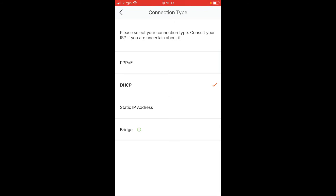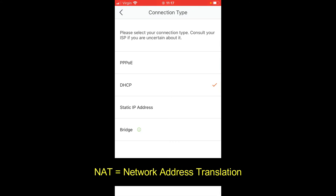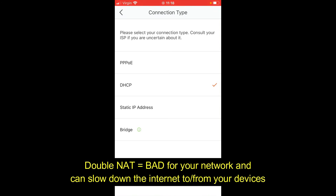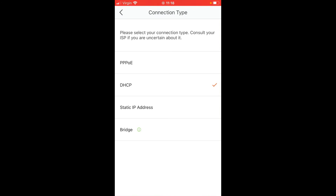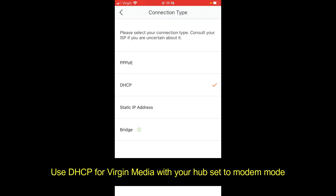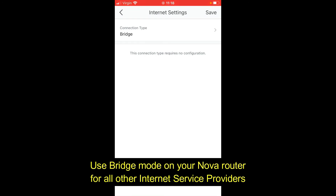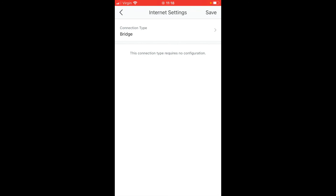If connecting via DHCP, make sure your ISP device is in modem mode, because the Nova devices will NAT your LAN IP addressing. If your ISP router is still in its standard configuration and you plug into a port on it, that router will also do NAT — resulting in double NAT, which is not ideal. So DHCP mode should only be used when your ISP router is set to bridge or modem mode. For Sky Hub or BT Hub users, select bridge mode so your Nova devices act as Wi-Fi units while your router retains full functionality.